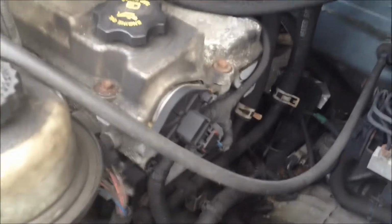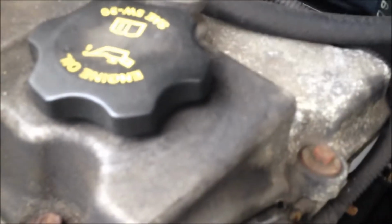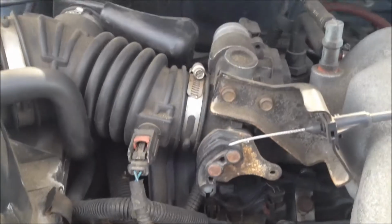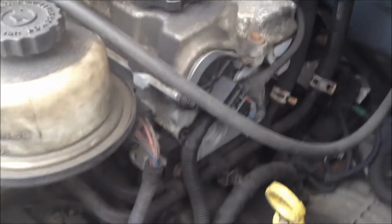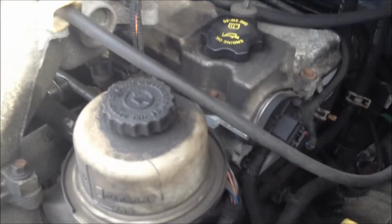We're looking at about 140,000 miles on this bad boy. And I'm just going to change the spark plugs here today, but damn it, this thing is beat to shit. The engine actually blew up 2 years ago or so. Timing belt broke, and of course when that happens the cams stop and pistons hit valves which are hanging open, and you get a big time kablamo in about a second. So that's what happened. About $4,000 to rebuild the motor.